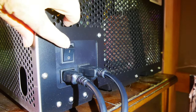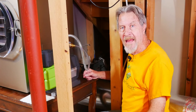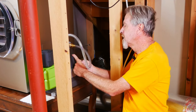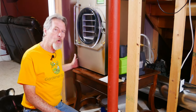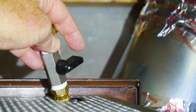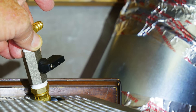The next thing to do is turn it on — the vertical line is on. Go ahead and turn the switch to on for the pump as well. On the back towards the top of the unit is the same kind of switch. On the other side of the freeze dryer, the left side, is the drain valve. We need to make sure that is closed before we start a freeze drying process. This black handle controls the valve — if it's perpendicular, it's closed, and that's what we're looking for. Now we'll make sure the door is fully closed. It locks in place, and you'll actually be able to see through the acrylic this black ring, which shows that it's got a good seal.